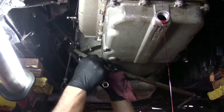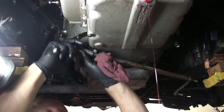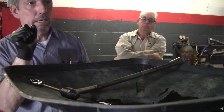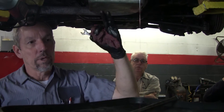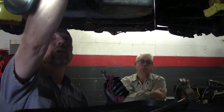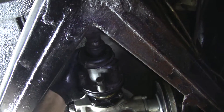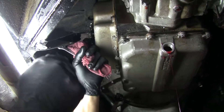Is this the one where you put it in reverse for the park position? Yes. The Hydromatic did not have a true park - when the engine is off, you put it in reverse and I'll show you how that mechanism works. When the engine is running, there's a piston pushed out by pressure from the torque converter, and it releases the lock. As soon as you turn the engine off, pressure goes to zero, the lock comes in, and it locks the drive shaft. When you put it back in reverse, that locks the drive shaft.